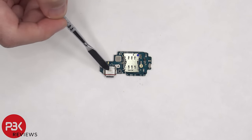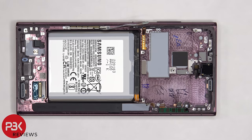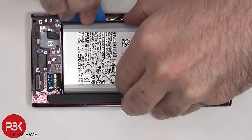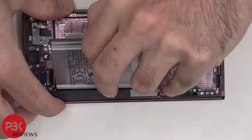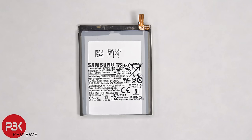The primary microphone is located here and the SIM reader is located on the back. There's also a red rubber gasket around the charger port. As always with Samsung, there's no adhesive pull tabs to help pry the battery off. So we're going to have to apply some isopropyl alcohol around the edges of the battery and let it sit for about 30 seconds so it eats away at the adhesive underneath, making it easier to pry the battery off. Here's a better look at the 5000mAh battery.